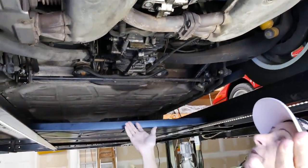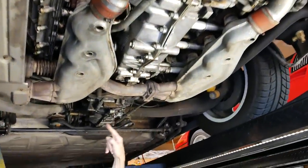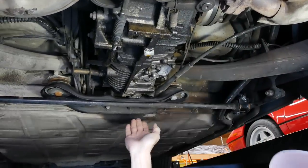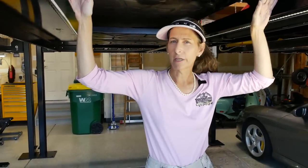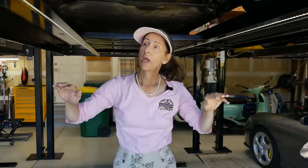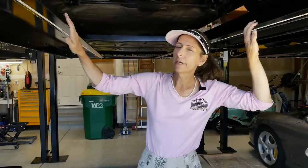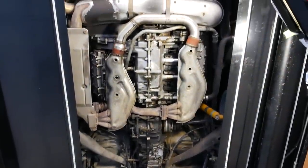Underneath here we've got two big bits. We've got the engine back here, and then forward here this brown crusty bit is the transmission. We've got four mounts — two mounts in the front and two additional mounts back there. Here's the big problem: the distance between these rails on the lift is about 31 inches, and this engine needs at least 36, more like closer to 38, to drop straight down. That's the problem with a four-post lift — that's why we can't have the car on the lift when we drop it because we'll have nowhere to go. And this back bar here is going to be in the way of the lift too.